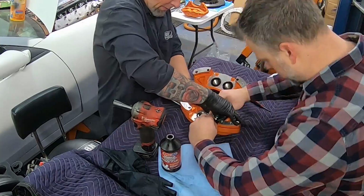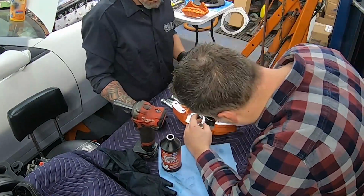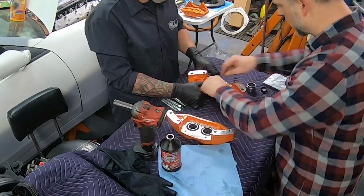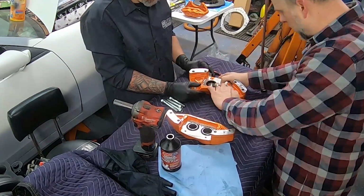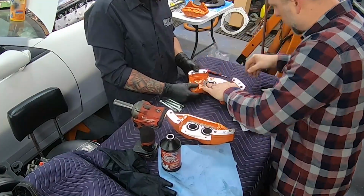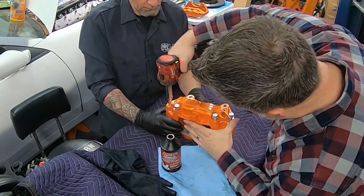Once the pistons are back in the bores, it's honestly really easy to just bolt the two halves of the calipers together. Just always make sure that you use brake fluid itself as a lubricant on the seals, basically wherever any rubber seals are going together on the calipers. And also make sure you have the O-rings in place that form the fluid connection between the inside and outside halves of the calipers.